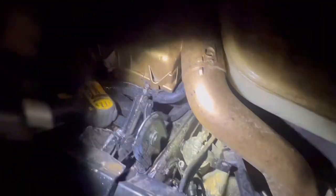So guys, checking this ground wire right here. I'm taking this bolt out. I'm gonna clean it up really well. I'm gonna try to look for more, but I know I had one here, back of the motor, back side over that way, and then back of the trunk or whatever. So I'm gonna see what's what. So guys, when I pulled these wires apart, I did have some white oxidation. I know that's normally not good. So we're gonna clean up this area really well.